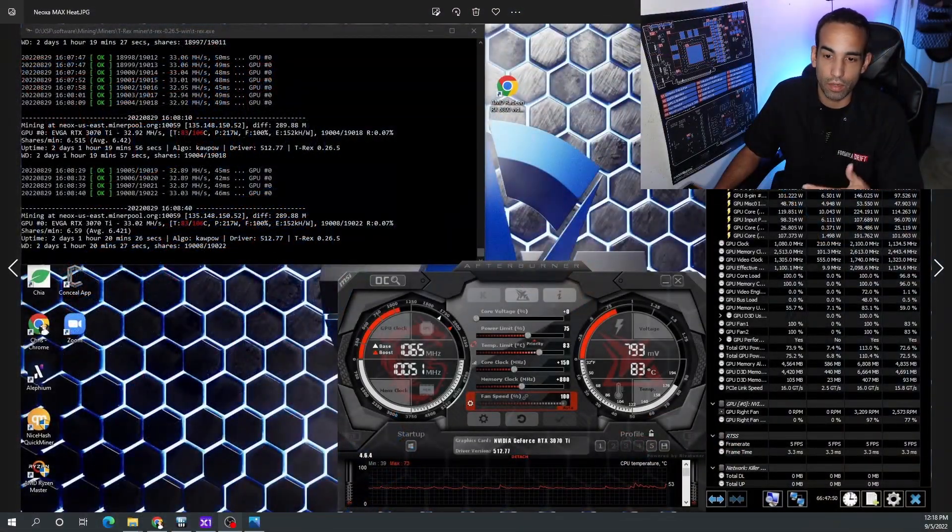Been testing out the 3070 Ti for quite some time, really putting it through its paces, and the temperature improvement is pretty good. Before I show you some charts, here's what I got maxing this thing out. On Neoxia, with power limit at 75 and a little core and memory overclock, we're drawing about 220 watts. The core hit a high of 85, the hotspot temperature hit a high of 94, and the memory hit a high of 108 with an average around 105-106. T-Junction on GDDR6X is 110, so you always want to stay away from that — really want to stay under 100. Running 24/7, I'd say max safe is 94-96.